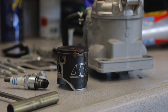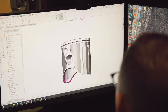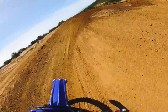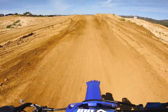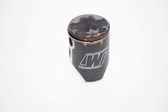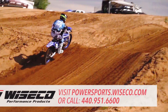When we have a part tested and it comes out looking good — like it hasn't been run at all — it's further validation that our skirt shape is really well and that the coating is holding up really well. The coating takes up a little bit of the clearance to the bore in a running engine. In a two-stroke especially, it helps eliminate some of that noise you hear with the piston motion, and it lets the piston rock a little bit less, which helps with the power. We received the part back and it was really promising — the skirt coat held up really well, the piston shape worked really good, and our mating components worked really well. We were excited to see that part come back and get used through its first trial period.